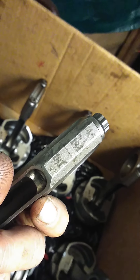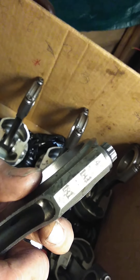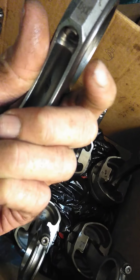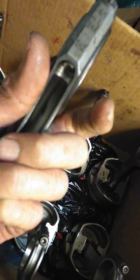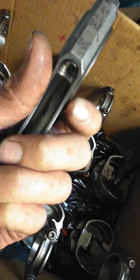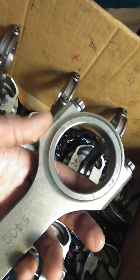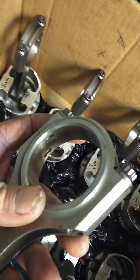Here's the outside piece — this has to go to the outside. This smoother piece has to go together against the other rod. Now if you get this chamfer messed up, you're going to make mistakes. There's going to be issues with your motor. So this is an important thing to know when going with H-beam rods.